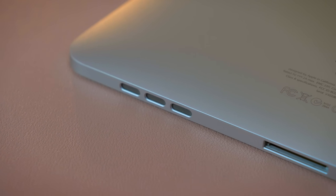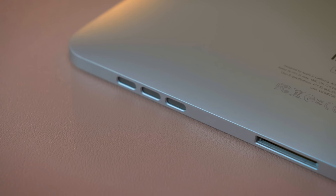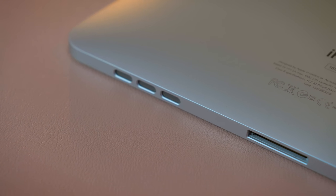In fact, there were 4 different Apple products that used the A4 chip, but none of them were implemented in the same way. There was the iPad, the iPod Touch 4th generation, the iPhone 4, and the 2nd generation Apple TV. Because the iPad is a larger device, it's able to effectively dissipate more heat, and so Apple was able to put the full-fat 1 GHz A4 chip. But for the iPod and the iPhone, because they're a smaller package and they need to be more efficient, they underclocked it to 800 megahertz.